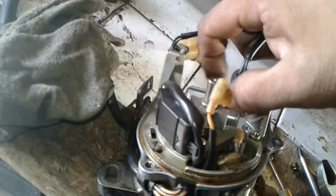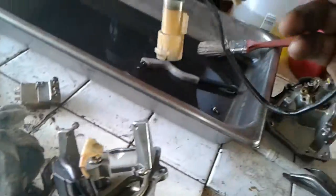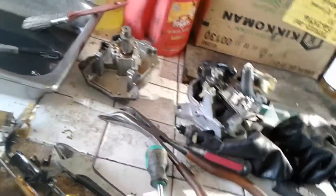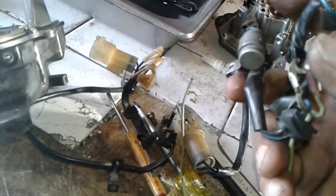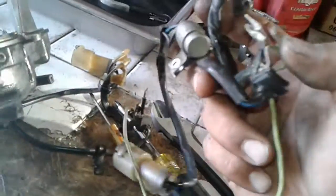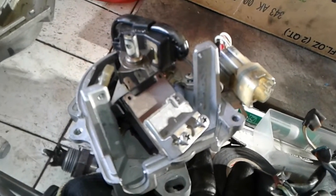Now you've got a better visual — the harness is ready to come out; just slip it under and over. My new distributor is here and this is the other one. This one has a condenser and somehow the wiring harness isn't passing power — somebody put another lead tied into where the white wire goes, stuffed it through the rubber grommet, and put a new wire on it. I don't want it rigged up, I want a professional distributor rebuild, so we're setting that one to the side.